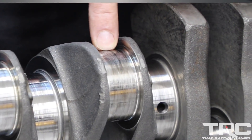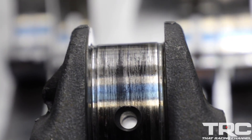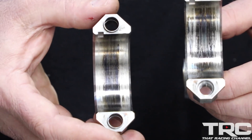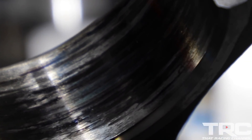On the crankshaft, you can see discoloration on the journal — this rod journal will have to be resized. All the rod journals will be resized. The crankshaft is not actually bent, so it'll be serviced and put back into another engine. The rod that the bearing failed on has this discoloration, and that discoloration is not going to go away. This rod should be thrown away.